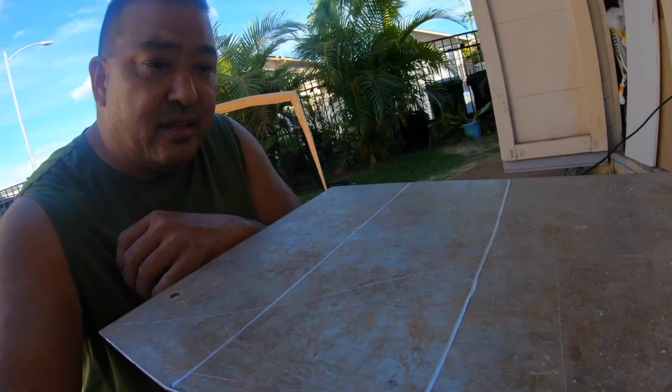But the other thing with aluminum is if it is bent fast, then it should be good. If you bend it slow, that's when it cracks. So I'm gonna take this piece of aluminum, try to put it on the edge of my wall, or even a 4x4 square. Try to smack it and see what I come up with. I'm not sure which way I'm gonna make the lines fold, if I'm gonna make it fold on itself or away from itself. I really don't know. I'll just try both ways and see what happens. So let me strap the GoPro onto my head and go from there.